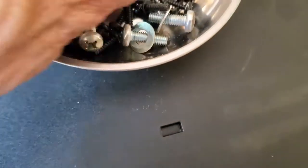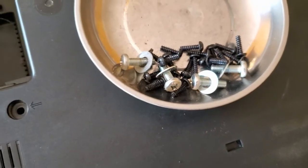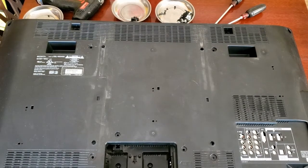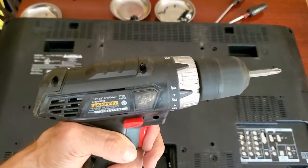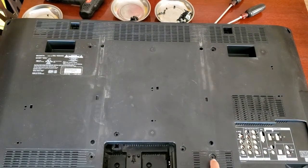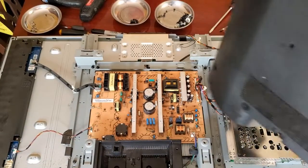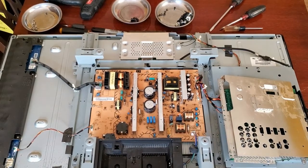These small ones go around the edge of the TV, and these are the ones that go sort of in the center all around. There's really no tricks on getting the cover off — there's just a lot of screws. You can use a drill for a little bit, but I just end up using a screwdriver to be honest. Again, you're going to take any screw out that has the arrow on it. Those little magnetic metal pans are great for holding the screws. You can have to pry the cover up a little bit but it should come up without problem.